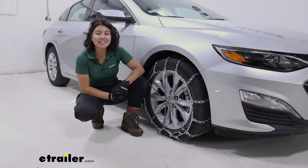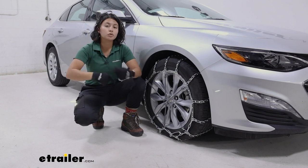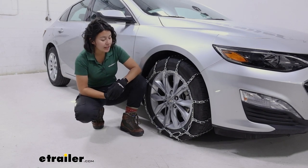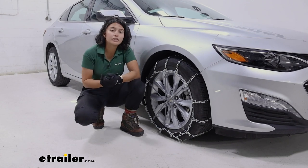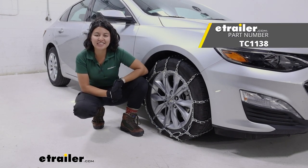And that's how you install your tire chains. Do the same thing on the driver's side. Afterwards, roll forward or roll backward a couple of feet, then check that everything is okay — that's one of the first things you need to verify before you hit the road. And now you're ready to face the snow.